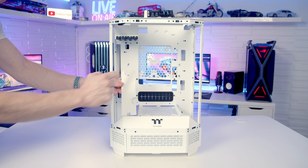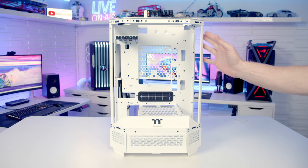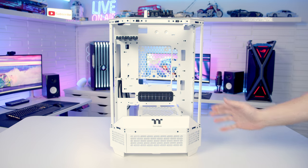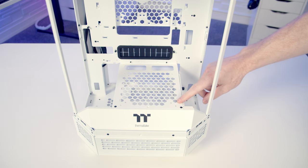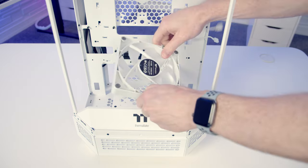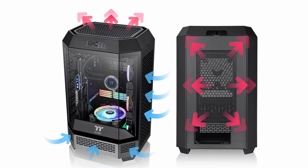There are little cutouts for routing cables through from the bottom of the case. The fan/radiator bracket on the side is your main source of cooling — you can fit up to three 140mm fans or up to a 420mm radiator, which is absolutely massive for a case of this size. For air cooling, Thermaltake supports CPU coolers up to 210mm in height. There's also one more fan mounting slot at the bottom with holes for 120mm and 140mm fans — you set the fan into place and use the long radiator screws included to screw it into the bottom of the case. Thermaltake have a nice diagram on their website explaining how to orientate the fans.